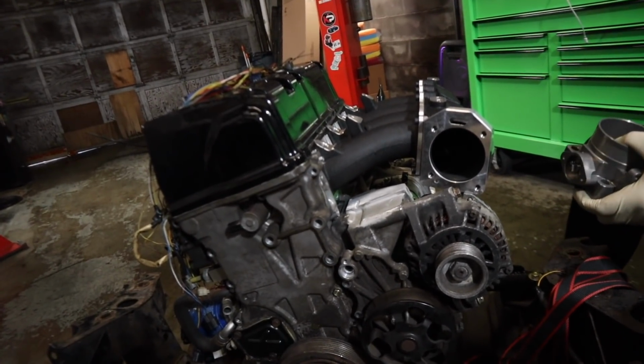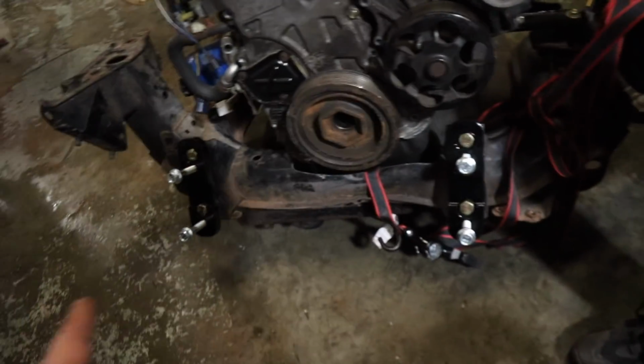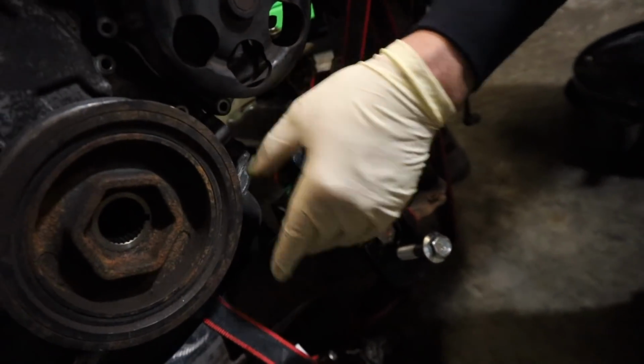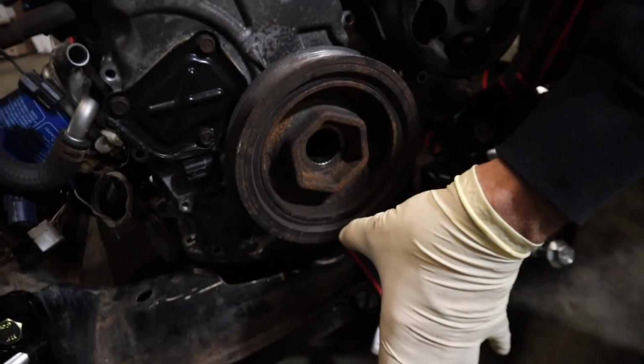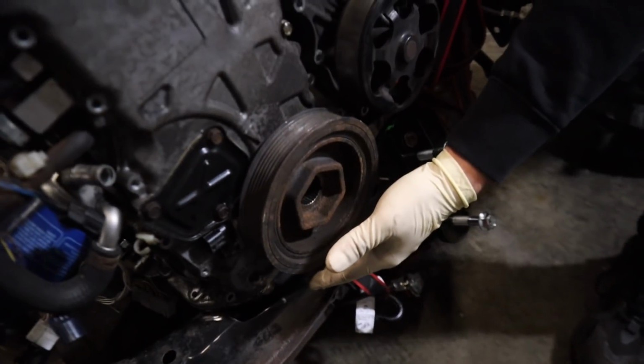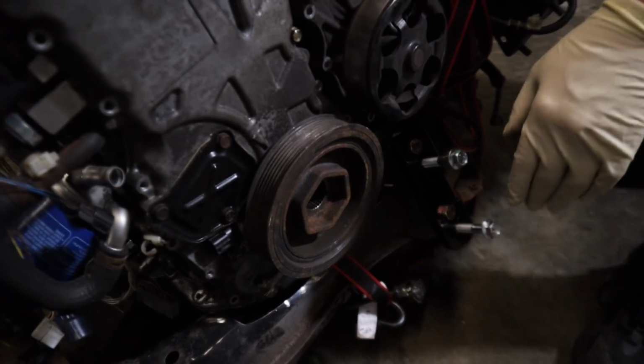That solution is finished. You want to talk to them about the steering rack? With the K, where it usually sits, it sits way too close to the motor. Since it has that electric power steering, it ends up hitting. Yeah, it was hitting our crank pulley. Yep. So what the spacers do is bring it out and down.